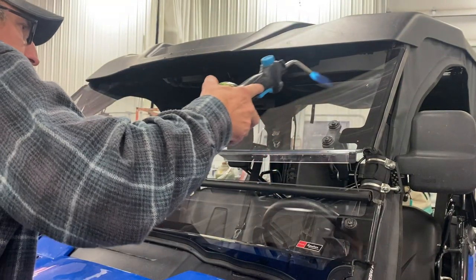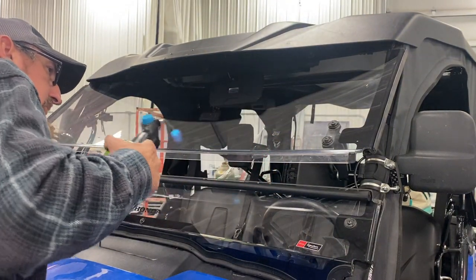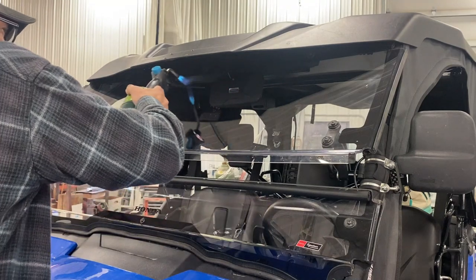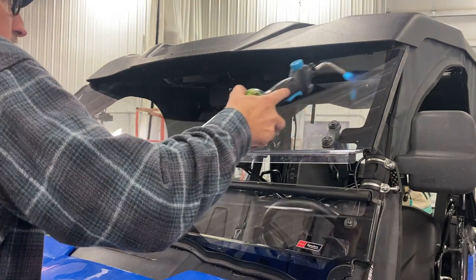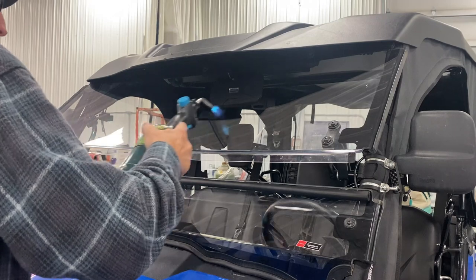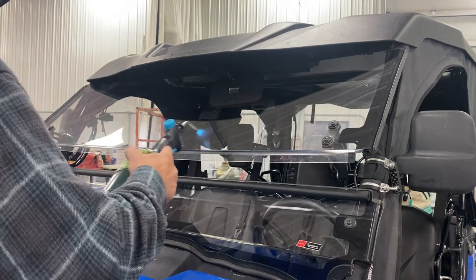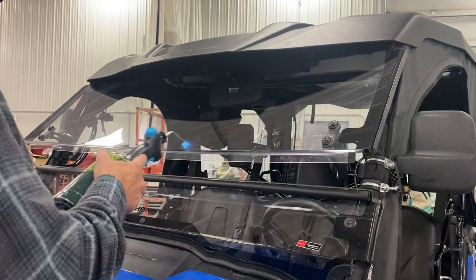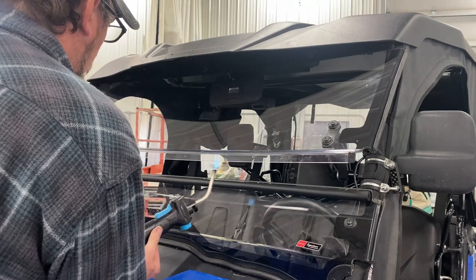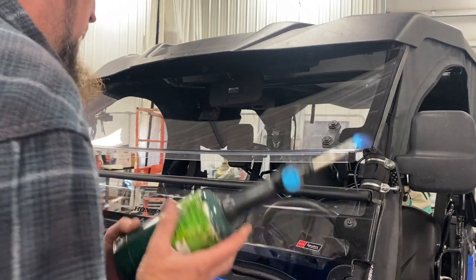Alright. We got one big scratch right down the center. We're gonna try to take that right out. And we are. Now I'm sure a lot of you are probably wondering, hey, we could do that on the rest of the plastic too and take the scratches out. I wouldn't recommend it. Not on the colored stuff, like the hood and all that. All you do is put little spots in it, and you take a chance at warping it. You don't want to do that either.